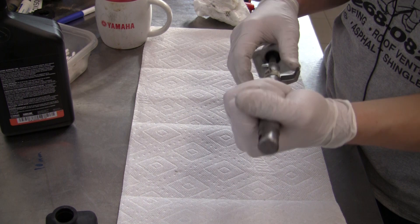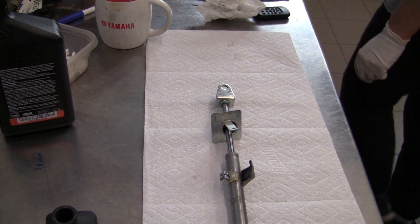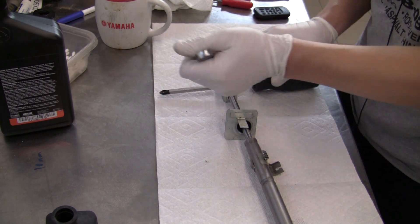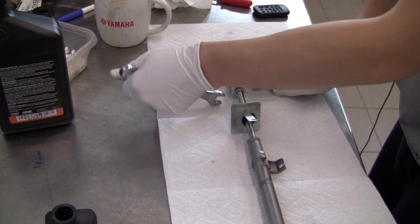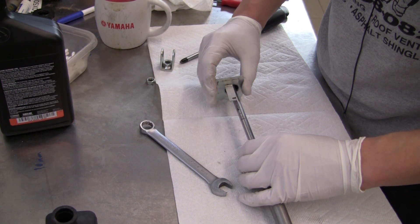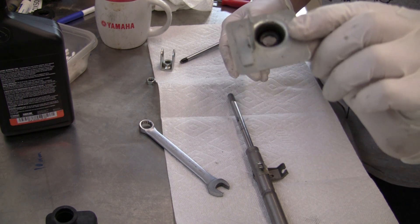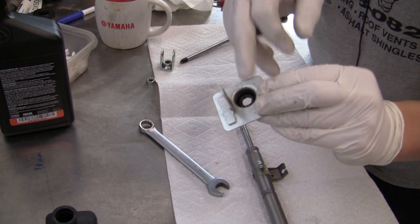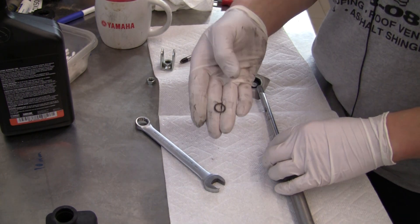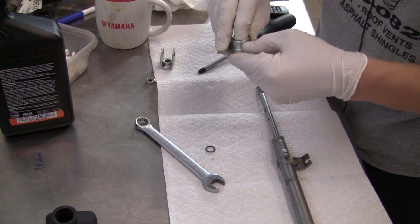Just trying to understand how this works — okay, so it's some type of compression mechanism. Let's get a 14 millimeter. I see two threads exposed, so I'll try this again. Now that I've got that I can get the bottom done — get the nut off. Now in here there's a seal, and what I've noticed is that the seal is completely finished. So I'm going to get the seal out. You can see that the spring on the inside of the seal is loose. I'll try prying this out — there we go, so there's our seal. We can see how badly that seal is torn.